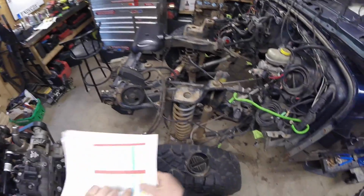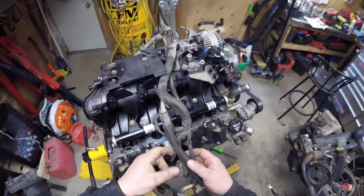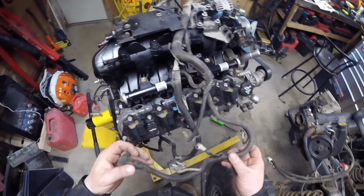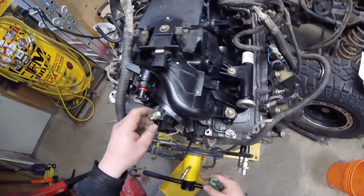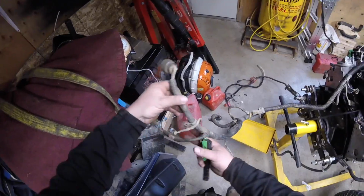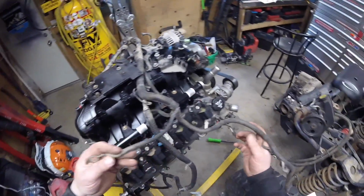Now on this side, let's put my sheets over here. Of course, we're gonna plug into that. Now, these are my injectors. Right down here, how would they go? There's an end plug. Oh, because it's a 3-wire. So that one's there. That one here, be the low oil pressure. Okay. Got a ground. These ones here will go down to my transmission. Okay, that part's settled. Now we need to figure this out now. Another grounding strap.